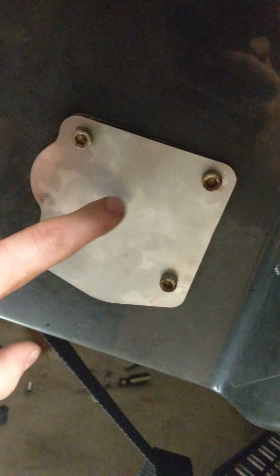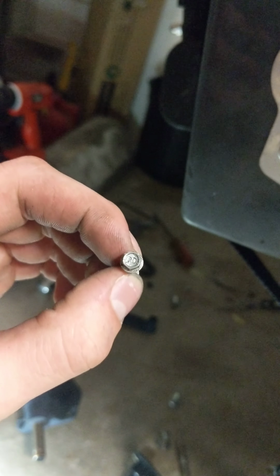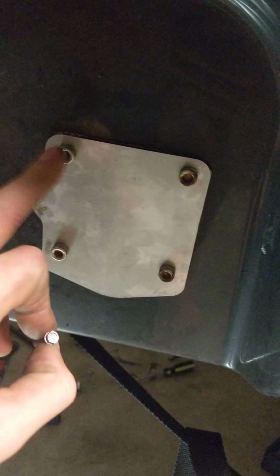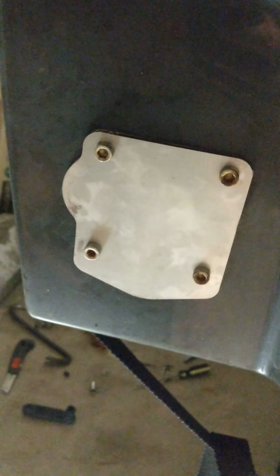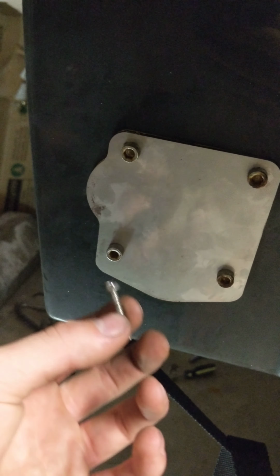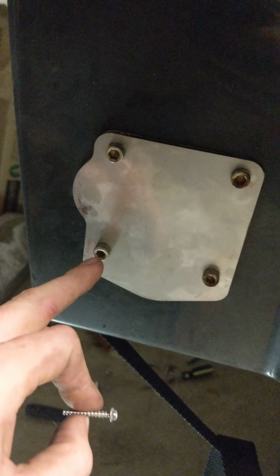Now, once you remove that piece and you have just nothing here, there's going to be a small little screw in between here. What that's going to be doing is holding a plate on the back end, the inner end of this jet ski, a plate with threads that these are able to thread into. I noticed the instructions on another site said do not remove this, and they are right, don't remove it because it will fall. So what you have to do is just start with threading.